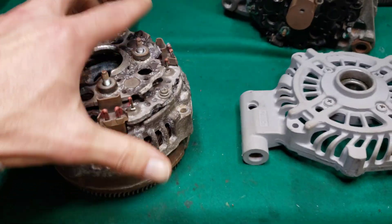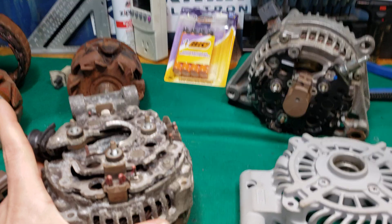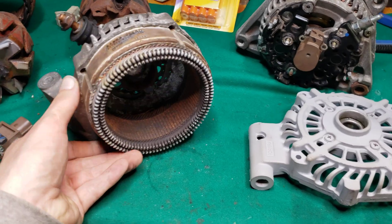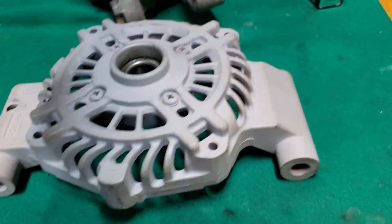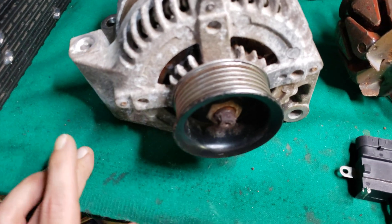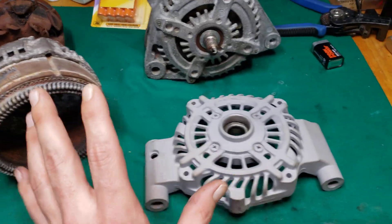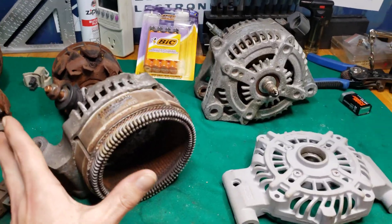The main thing to know is there are two different size Denso hairpins: a large case and a small case. Which one fits your car, you'll have to research. The reason I use these is because there are so many different housings available — literally tons of different stock housings. This one has the mounts this way, this one has them staggered off, and this one is completely different yet with a bolt down and one of these style mounts. There's a bunch of different housings, and chances are one will fit your vehicle stock. If not, it's usually a slight modification on one of the brackets.